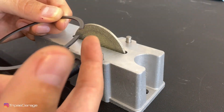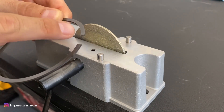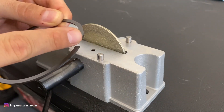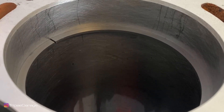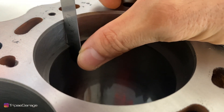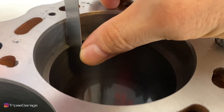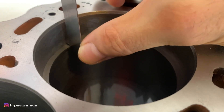There are going to be burrs on the ring where you just ground it down. Take a fine file or fine sandpaper and hit the edges so there are no sharp edges — you don't want those scratching up the inside of your cylinder walls. Moment of truth: I filed them down, checked them very frequently. At 24 thousandths of an inch, that fits in there perfectly. Trying 25 thousandths to see if I overshot — 25 thousandths does not go in. Perfect.